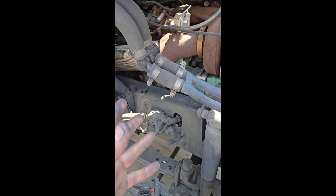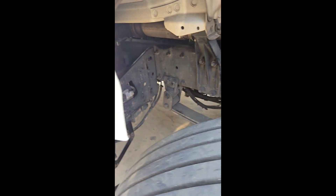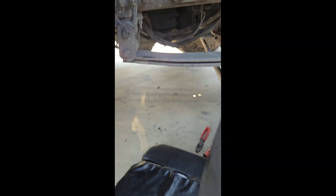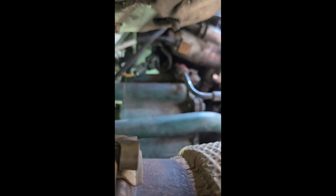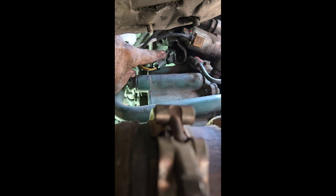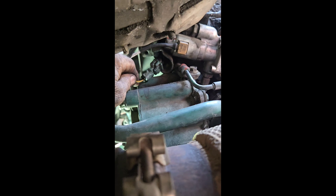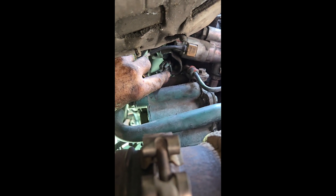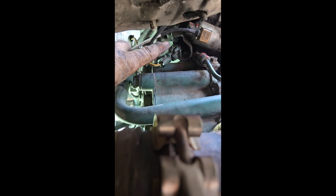Fire this mug up, turn it to the left, get this out. When you get up under here, you'll be able to look right up there — that's your cam sensor. If you don't know how that works, you squeeze down on the end of it, pull it, and unplug it. It takes a 10mm socket to remove it.